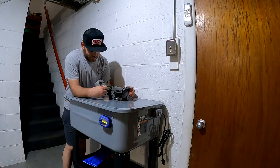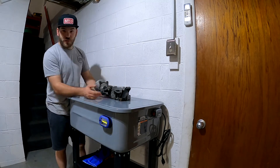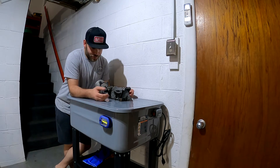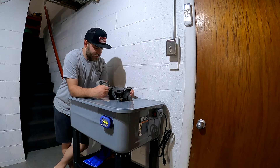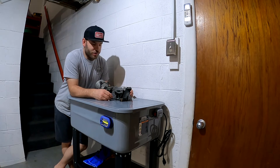I don't want the thing to be spotless, I'm not going to spend a ton of time, but I want it to be cleaner than it is. Same with the oil pan and any other brackets I encounter as I go to put it back together. So let's see how clean this thing comes with this parts cleaner. It's not really going to look like anything on camera because I didn't take any close-ups, but the oil filter housing is definitely much cleaner than it was. The parts cleaner does exactly what I needed it to. I'll wipe it down a little more and blow it out with air before I actually put it on the car.